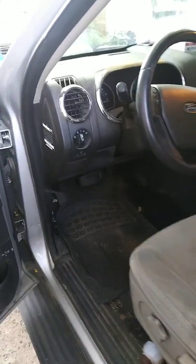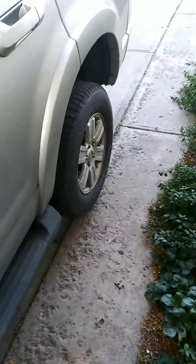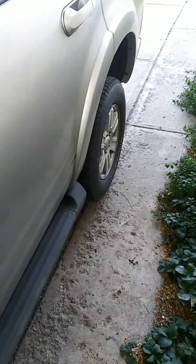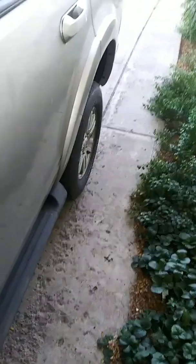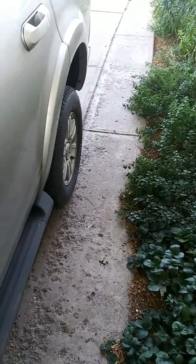Alright, back to what I was doing. Okay, everybody, tank's in. I went and got some gas, threw some extra gas in it because it was really super low, and I didn't want to start the pump on a super low tank. I've still got it up on the jack stands, as you can see, because I wanted to wait until I had everything done and started before I actually took it off the jack stands. So just in case it starts spewing gas at me from something I didn't connect right, I wouldn't have to put it back up on the stands.